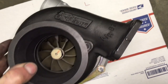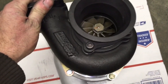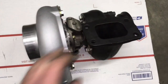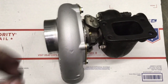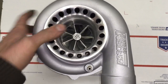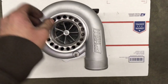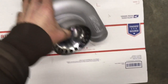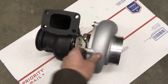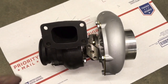It's also called a T350 turbine, if you're talking in Garrett terms. Because of the tip height of the 60-1 compressor wheel being so tall, it's limited on what you can upgrade it from once you've already converted it. We had a couple options — like a 35R or a GTX 3582R. You may be able to go to the GTX 35R from the 60-1, but I'm not really 100% sure. So it's a good idea to know what you want to convert it to and what your goals are before you choose a compressor wheel, because you may not be able to upgrade it from that point.